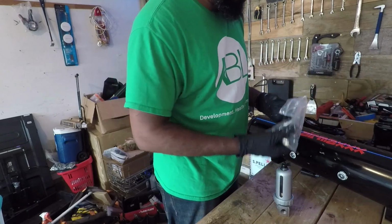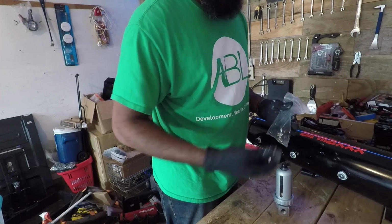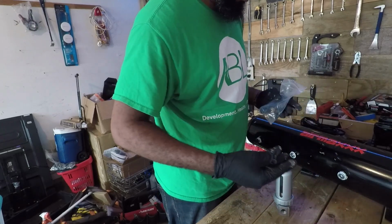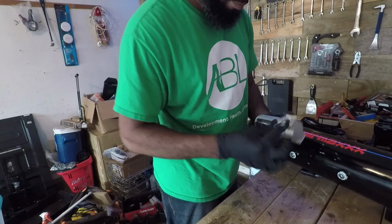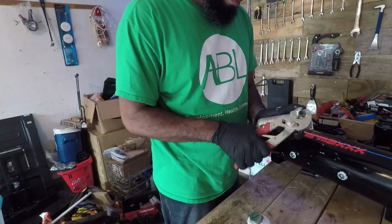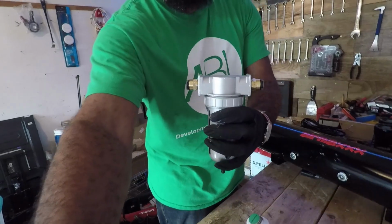I don't know, maybe it'll read the pressure readings that are closest to the line instead of the bags, and I need them as close to the bags as much as possible because I want the readings to come from the bags so I know how much pressure is in each bag, not the line. I don't know math. I don't know if it's gonna add up, but we'll play it by ear. And I think just to be on the safe side, I'm gonna put these fittings as close to the bag as possible. And there's my water trap fittings.